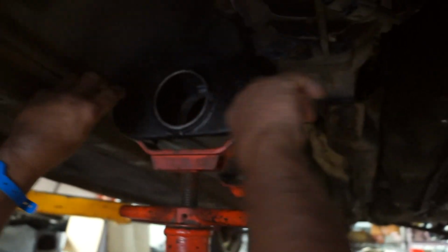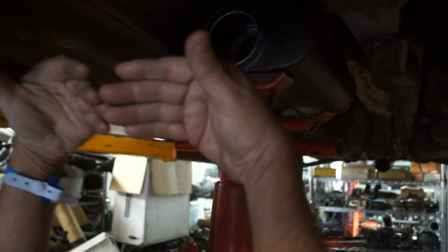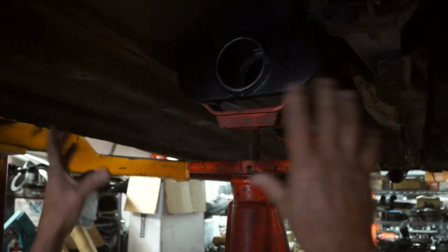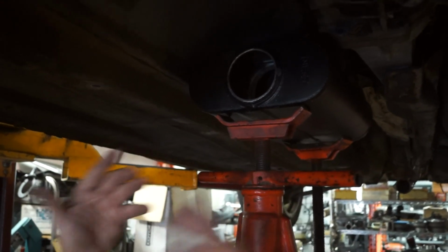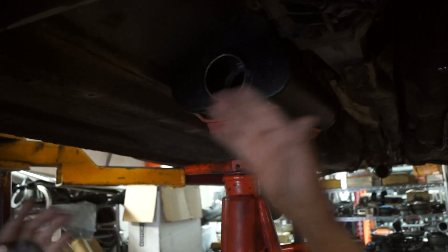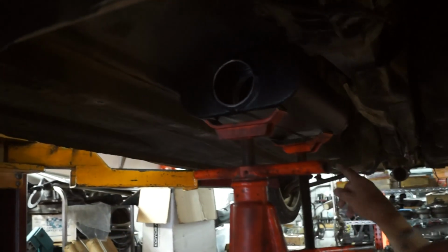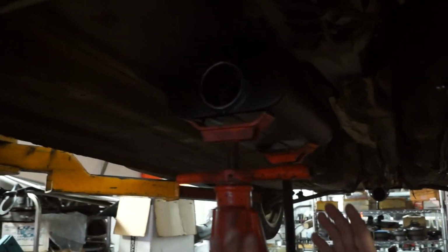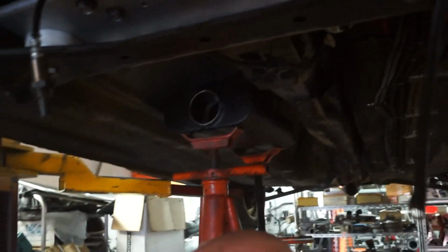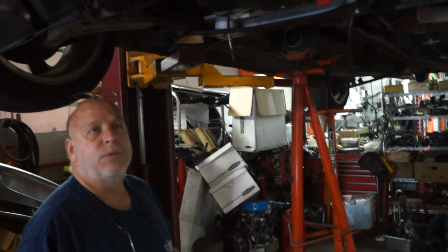You've got the downpipe. Oh, you took it off? Yeah. Don't mess up my suit. See, that works really nice because you've got these chambers that open up, and then they run along the sides. Whatever's coming in under pressure hits that V, and it's forced to go to the side. All that mixes together and adjusts the velocity of the air coming together. Somewhere on the line here, there's another couple of these, so it has to make turns. Baffles, let's say. Then they come together and direct it out the back. Depending where they place them, it adjusts the sound. It's pretty cool technology. The beauty of it is that they absorb a lot of heat and really don't slow the flow.